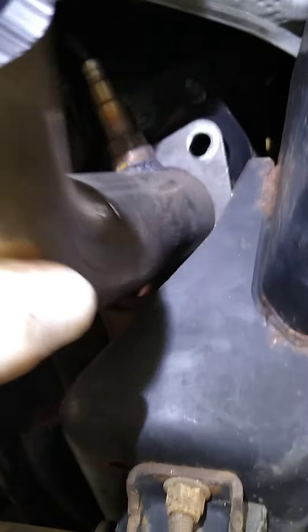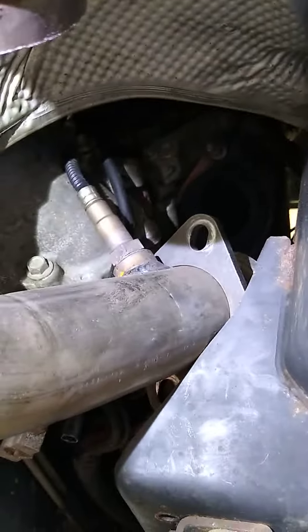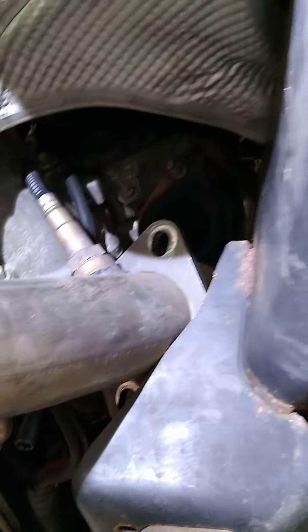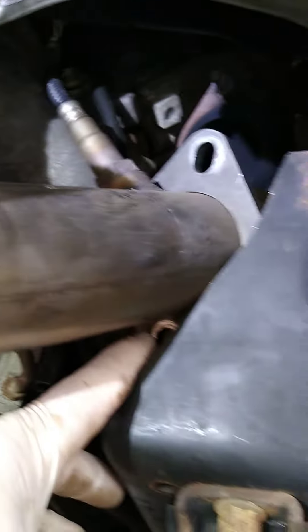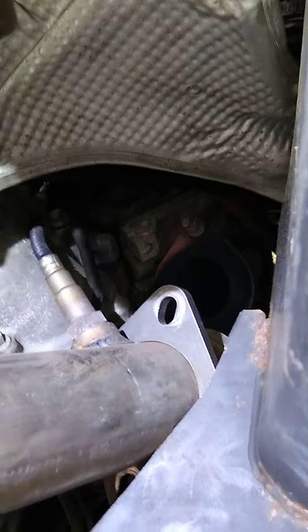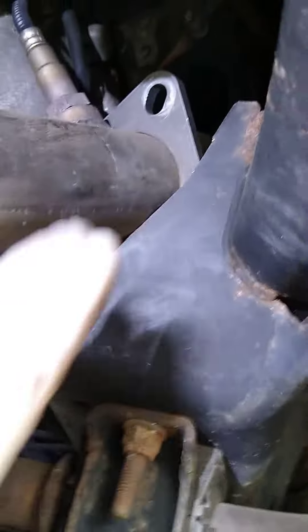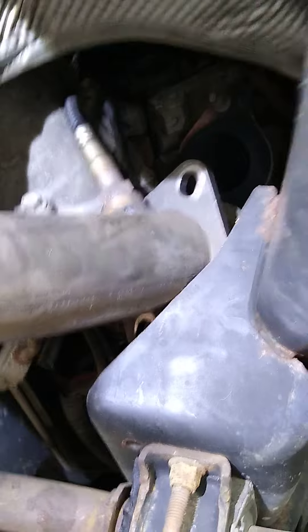It's a flare compression fitting. To fix this, you could drill out the flanges and use studs without shoulders, but what we're gonna do is put the flange up, get the nuts on two or three turns, and then spot weld the flange lower down on the pipe. When you tighten it up, it's gonna push the whole pipe up into compression against the manifold. That's the simplest fix.